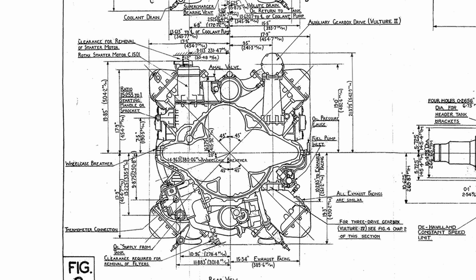At the core was a hollow, six-throw crankshaft held in place between the crankcase halves and supported by seven main bearings for stability. Each of the four monoblock cylinder banks was crafted from aluminum with an integrated cylinder head, and steel liners were fitted into each of the six cylinders within the banks. These banks were fastened to the crankcase by 26 long studs. The cylinder spacing was increased compared to the Kestrel to accommodate larger connecting rod bearings and to allow for future upgrades in bore diameter.